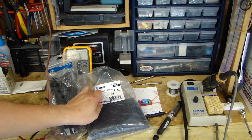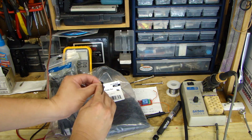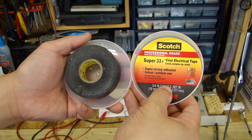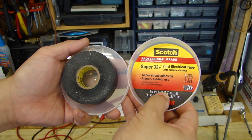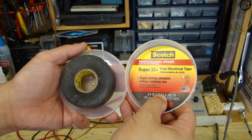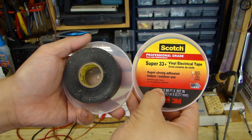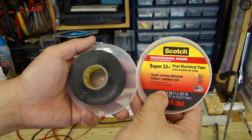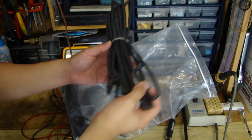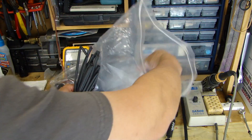One thing to note: stay away from the brand called Vanco. I got these off eBay a couple years ago and I'd say half of them will fail — after you bundle the wire, the locking plastic tab inside is not strong enough and it'll come undone. Another thing you'll be using a lot of is electrical tape. Don't buy the cheap stuff because after a year or two in a vehicle, the tape gets hard and the glue starts dissolving, and the whole tape will start unwinding causing an electrical short. I like using 3M Scotch Super 33, rated up to 221°F (105°C) and down to -0.4°F (-18°C) — very good tape. In this bag I have heat shrink, which comes in different sizes. Whenever you do electrical work you'll either crimp wires together or solder and put on some heat shrink.